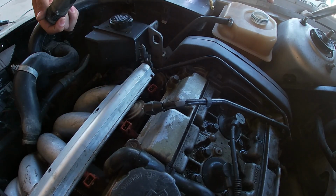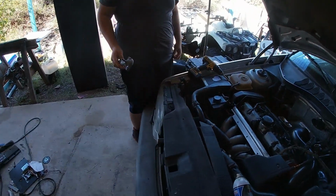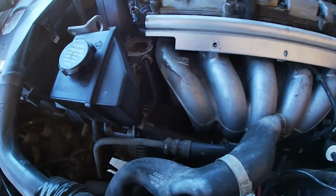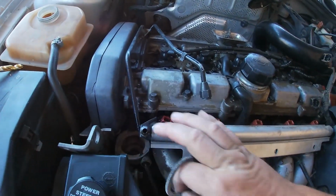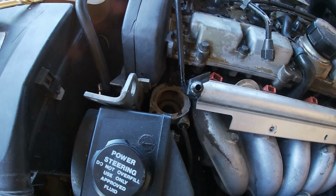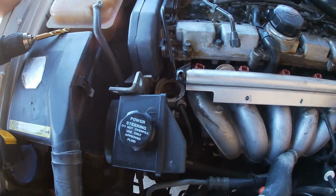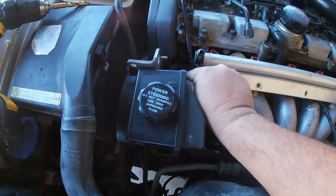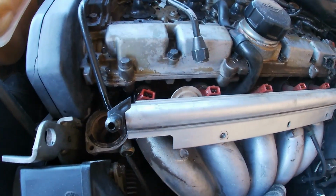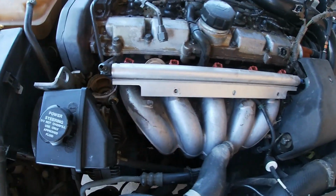That took way too much. But I don't see a thermostat. Yep, there's not a thermostat at all. So our thermostat was definitely not sticking. But this also tells us something else, because it looks like, oh, nope, there it is. There's our thermostat gasket. We don't have a thermostat, Dad. At all. Very interesting. Is that how come it didn't want to come off? It didn't want to show us its true colors. Like Crossfade said. Well, somebody definitely over-torqued that thing, because otherwise they wouldn't have been able to get the thermostat out. I think we have a liar on our hands.